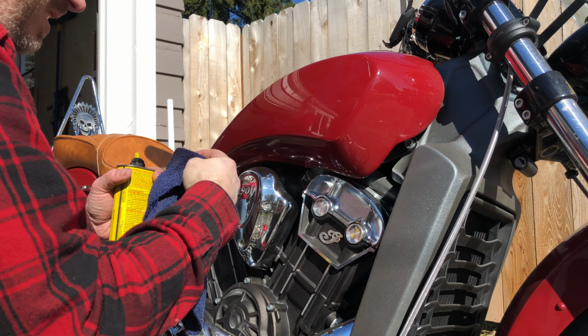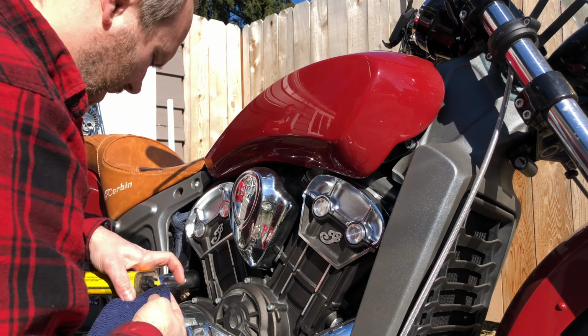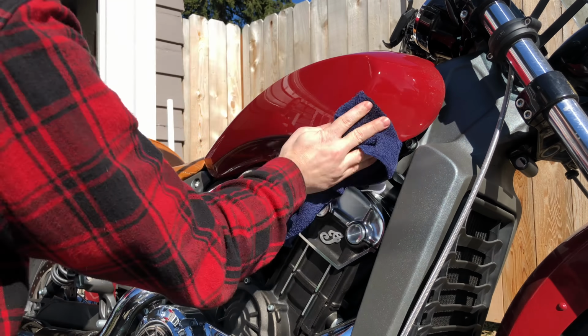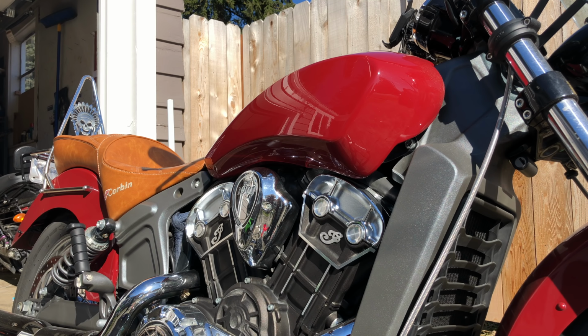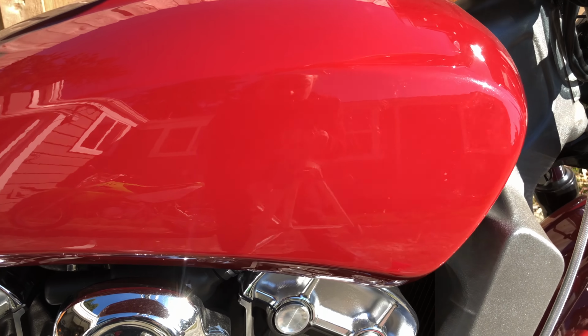After I've rubbed off the adhesive film by hand, I start with Goof Off on a rag to remove the remaining adhesive film, which turns it into a tacky rubber-like substance. It comes off pretty easily with Goof Off. Once I feel like I've gotten all of it off, I switch to denatured alcohol to clean up the Goof Off residue in order to prepare it for the vinyl decal install.